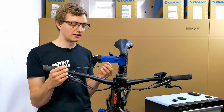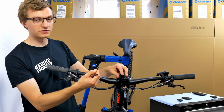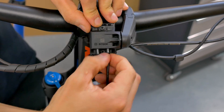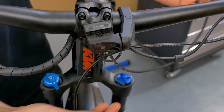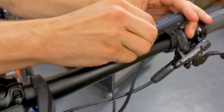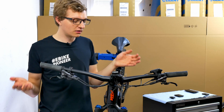We now have a second cable as well, which was included in the delivery — in this case a 300 mm cable — which we can use to connect the display mount and the LED remote. Simply pay attention to the white marking, plug it into the second socket which is now still available, until you overcome a slight resistance, then it is firmly in place. Now we have to lead the cable from the display holder to the LED remote. This always depends on how wide your handlebar is and where you would like to position it. Here on the KTM electric bikes, there is a small cable guide that neatly conceals the cables. And by doing this, the display mount is already fully connected to the e-bike.